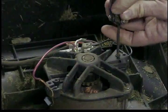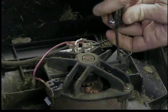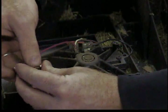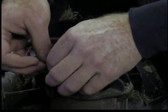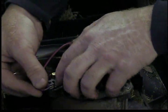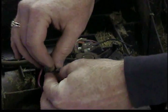Put the cap back on and tighten the torx screw up. On the other side it wasn't bad — I could replace it now that I've got it apart, but it's so easy I'm just going to save the second brush I bought and wait for it to fail. Note: I attempted to put it in backwards — the wire comes out the slotted side of the case, and that wire points towards the hole where you tuck the crimp into. Not that hard — it won't let you put it together wrong.